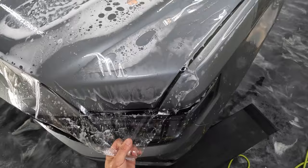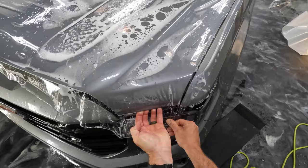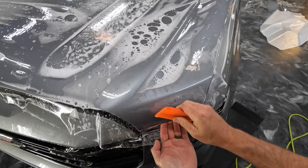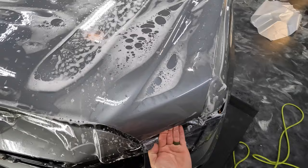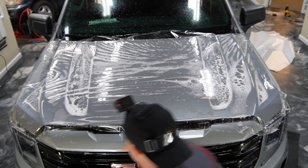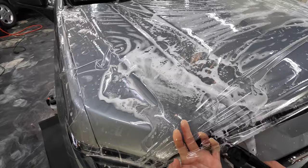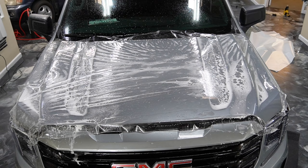This doesn't want to stay down that good. Since we've already stretched back there, we know we're not going to have any more stretching to do on this. So I'm going to go ahead and put some tack on there and then tack that to the underneath of the hood and then squeegee this part out. That way we don't have any issues with it popping off the headlight again. All right, there we go — no more pre-tacking. Let's do this.